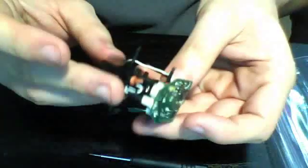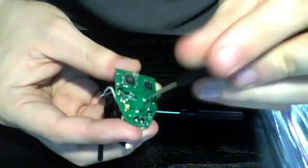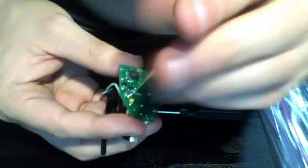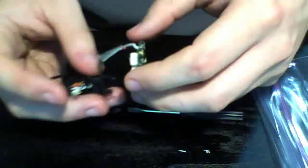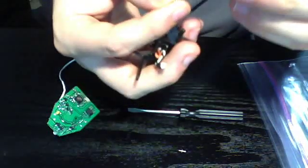Now it's time to remove the 3-in-1 board. First, remove the power for the main motor — a simple one-plug operation. There are two screws holding the 3-in-1 right in the middle. It's very important that you don't touch any of the circuitry with your screwdriver. These screws are fairly unique because they have a little washer on them that insulates them from the 3-in-1. Since they're special screws, I'm going to screw them back into the frame so I don't lose them.